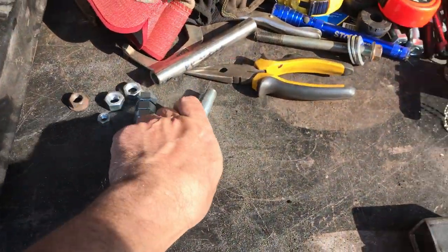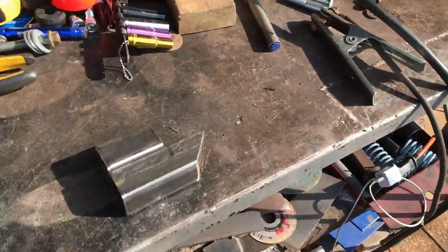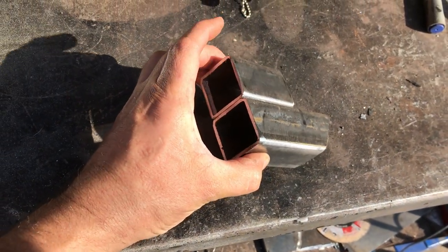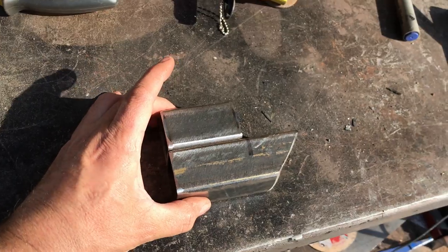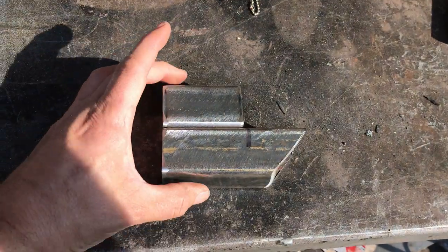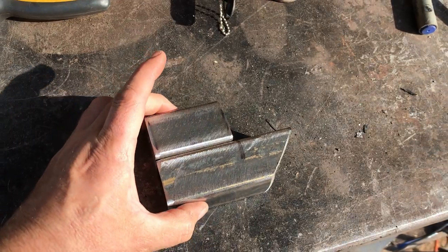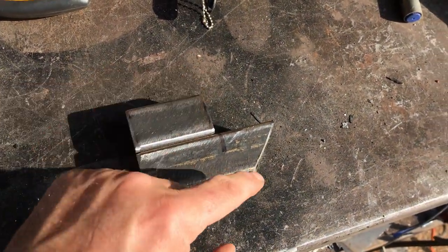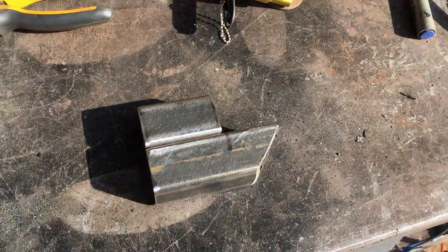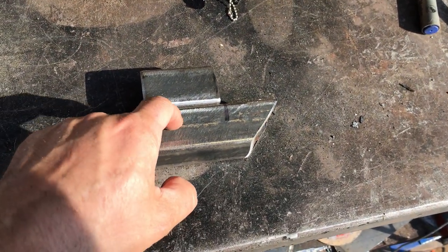Okay folks, I got my 5-inch bolts and nuts. Perfect, I put one in already and it's fine. The other side, however, it's actually 1.5 inch by 3 inch bar that's underneath the car, but on the other side it's short by 2.5 inches. So I need to make this, weld it up the middle and the back just to extend that, and then obviously weld it all around there. Still going to put a plate, a sort of roundish plate, on this and the other one before I'm finished. Right, I'll get this welded up and then mark where the holes go for the bolt.